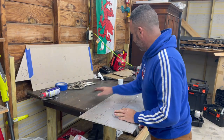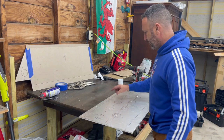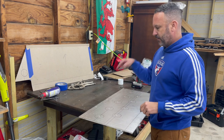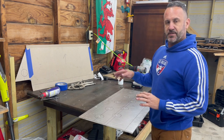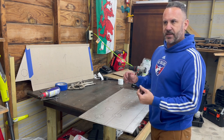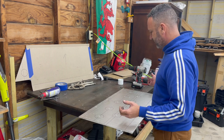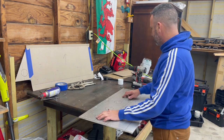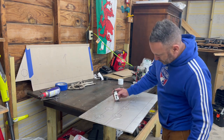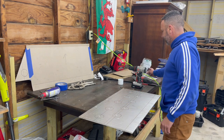All the pilot holes are drilled. I'm going to leave the top ones at 1/8 inch just to be a little more precise. When I clamp everything in I can start my drill process there and have the marks on the actual bumper, because the bumper piece is going to be what's tapped. I need to get that really precise and straight across the front since it's the first thing you'll see. The rest I just counter-sunk them so the hole saw can go in here and center up.